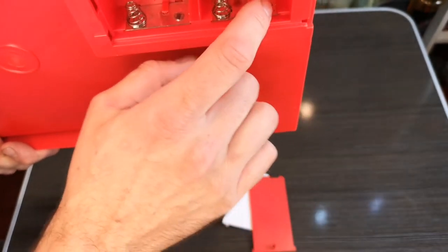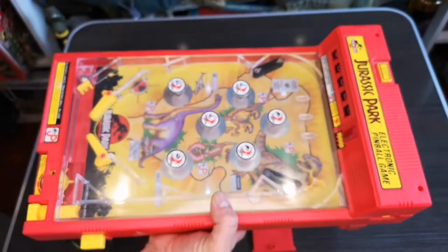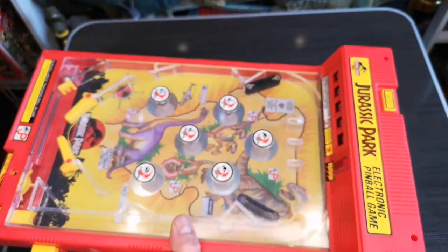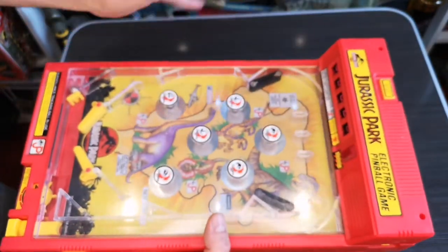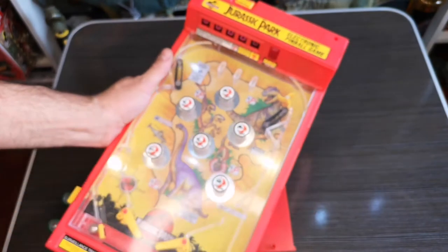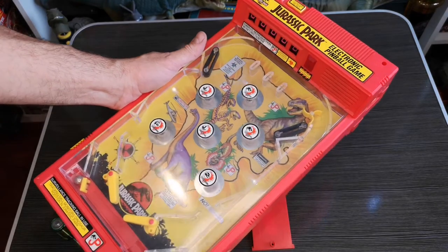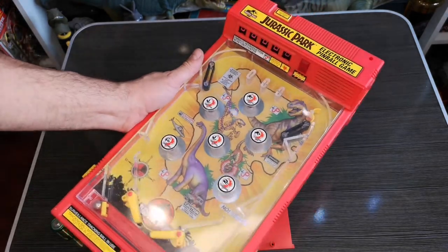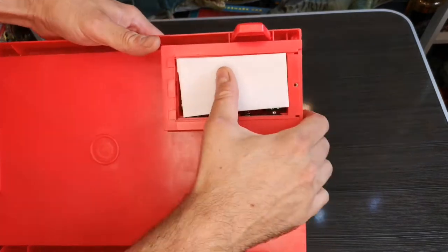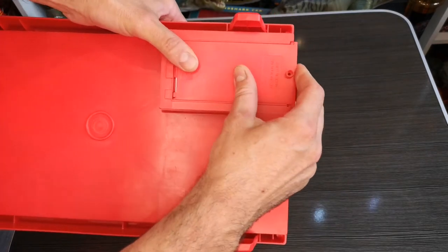I got some fine sandpaper just to take the roughness off the corrosion, because what happens over the years is batteries get left inside and start to corrode, eating the terminals, which leads to bad connection and the item won't work. I checked it and found it did come on but not straight away - on and off - which sounded like a connection issue. Looking again, I noticed that if I placed a piece of card to keep pressure on the batteries and then reintroduced the cover...